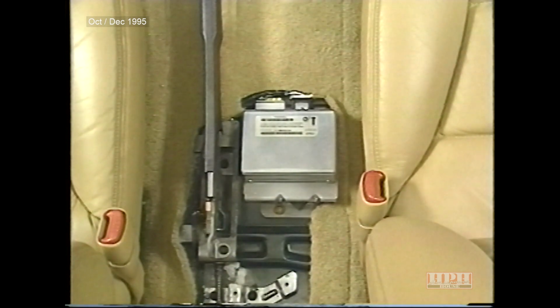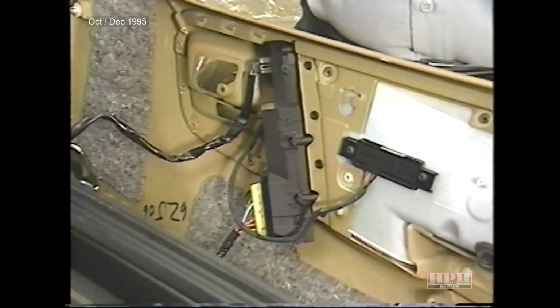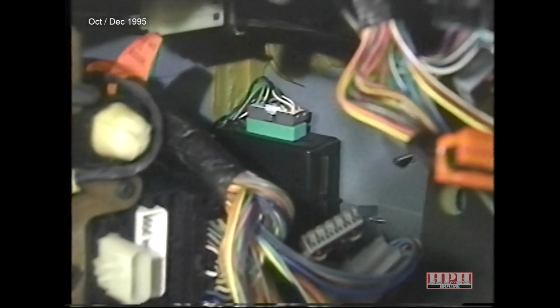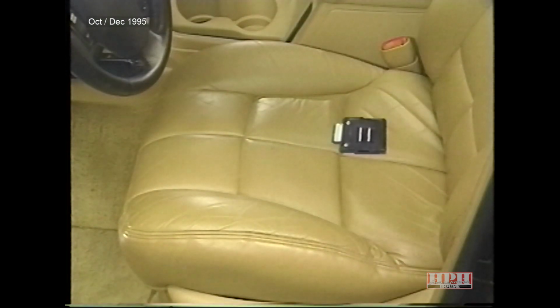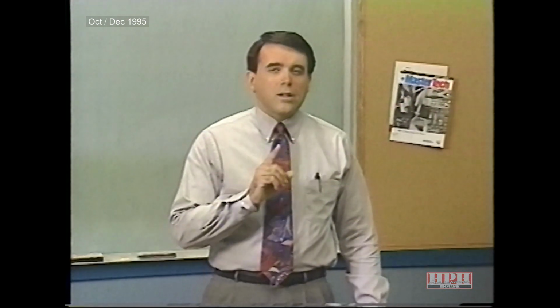Airbag Control Module, Memory Seat Module, and the driver's door and passenger's door modules. Modules that are not on the C2D bus are the Speed Proportional Steering Module, Controller Anti-Lock Brake, and the Heated Seat Control modules. Many of these modules are either new or different from last year. Let's take a closer look at them.